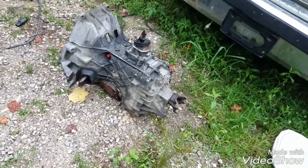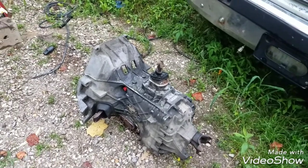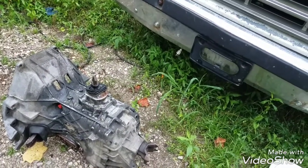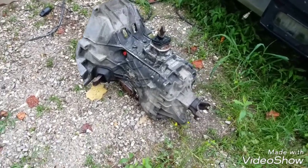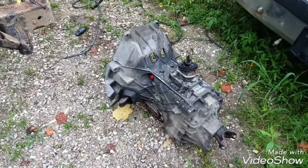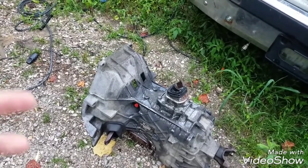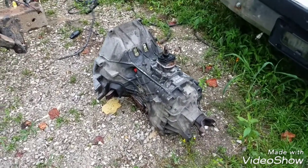The 7.3 IDI and the Power Strokes do interchange — the differences are in your clutch. The '95-and-up transmissions are the S5-47; anything below '95 is the S5-42. The difference is the gears are made a little differently. You can do a gear swap from a 47 into a 42 if you have a bad case on a 47, but you have to swap all the guts and internals at once because the ratios are a tad different.